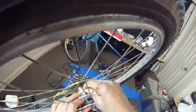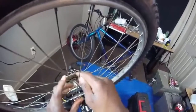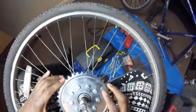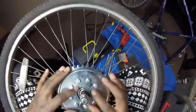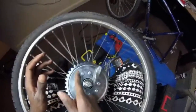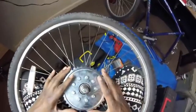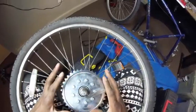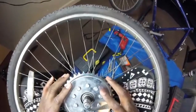I've almost finished putting the screws on all of them. Next you want to make sure this is centered — this is the main thing we're looking for right here. To keep your center while you're tightening it, go every third bolt and skip one, then go every other bolt again. Keep going. It's gonna move but you gotta move it as you're tightening it. They might shift, then you're gonna have to loosen some and center it back.